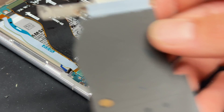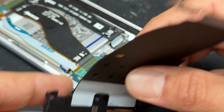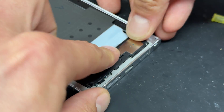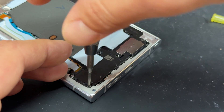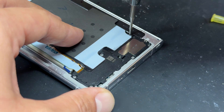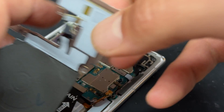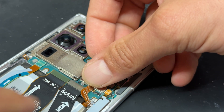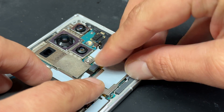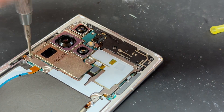Don't be tempted to test it just yet because if the wireless charging coil isn't attached you will get a warning notification on the screen, so go ahead and reinstall the plastic cover. Then once they're in place, go back up to the top of the phone, pry that back a little bit, reattach the battery, then the metal cover on top, reconnect the two connectors for the wireless coil and the NFC antenna, and re-secure the screws to hold it down.